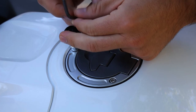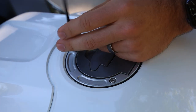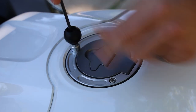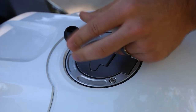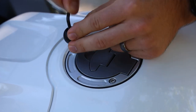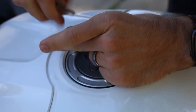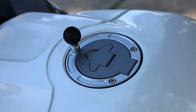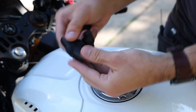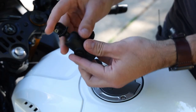This is going on some pretty soft aluminum right here, so you don't need to tighten it too much. If you'll notice when you take these off or tighten them down, they're not tightened very much from the factory anyway. Just give it enough to where it's pretty snug, and you can even line this up a little bit better if you want. It should look something like that. Then you'll just want to grab the double socket part as well as the GoPro mount and just pop that in there.